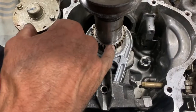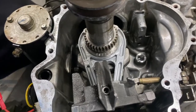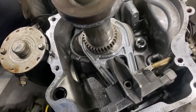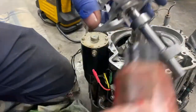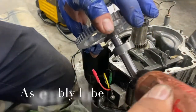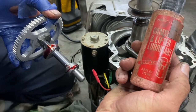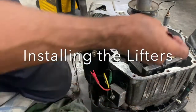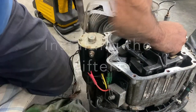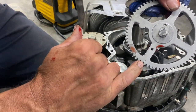There's a little dot on this gear here — I'm going to rotate that to where the camshaft is going to be. Just put a little bit of break-in oil on the cam lobes. There's the camshaft and the lifter lubricant. Stick them in the motor and push them all the way in.